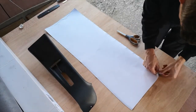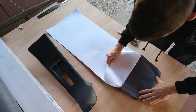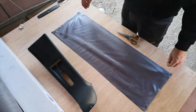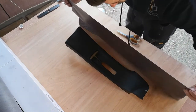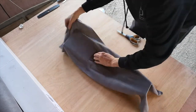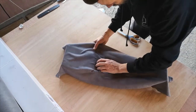Now we can look at removing the backing paper from the self-adhesive suede lining material. In this case we're rolling the material out and then laying it across the trim panel, making sure from the start that we get into the middle of the lowest point of the panel, and then we can start working out from there.